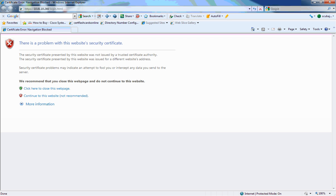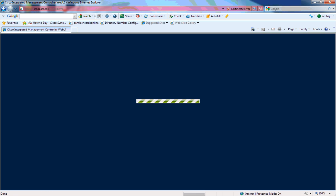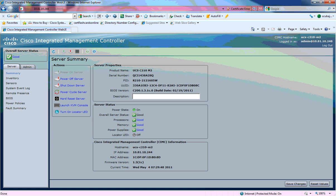At that point, I then HTTP to the Cisco Integrated Management Controller, and that's where I need to do some BIOS updates and a couple other things. The default password is admin — I've changed the default password to something else. The version 131C, we're going to be upgrading today to a newer version of the Integrated Management Controller.